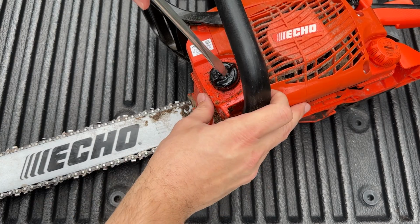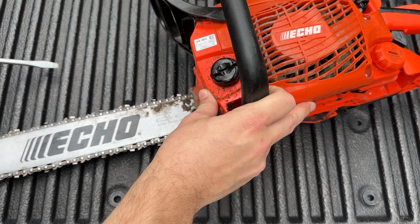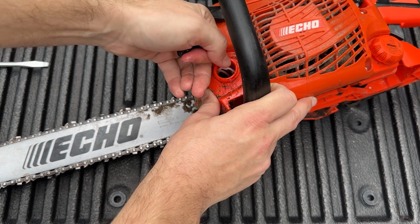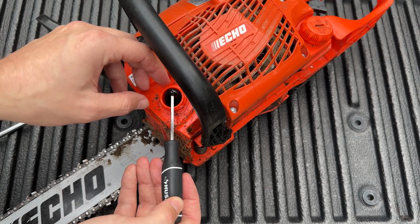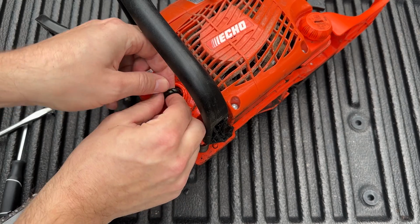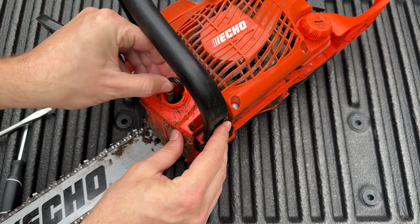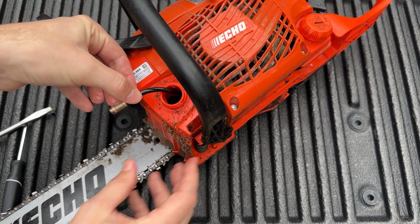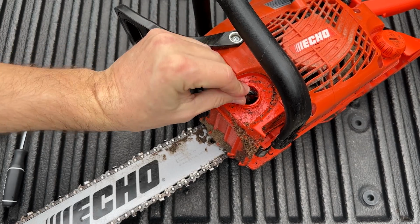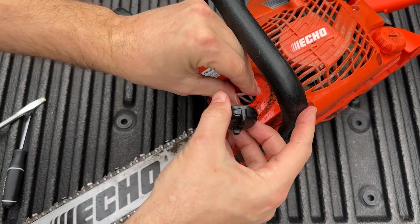It wasn't part of the maintenance kit, but I wanted to check it anyway since it was in the owner's manual. There's also a similar filter for the bar oil. It's the same idea as the fuel filter, just remove the cap and fish the hose out. This one was actually more difficult and I needed a small screwdriver to get it. When I checked this filter, it appeared to be pretty clean, and seeing as how a replacement wasn't included in the maintenance kit, let it ride.